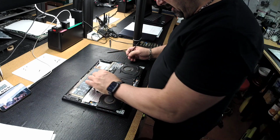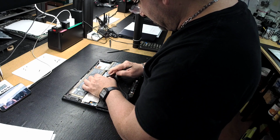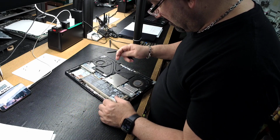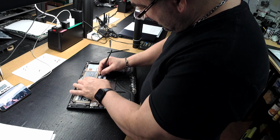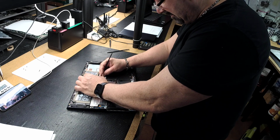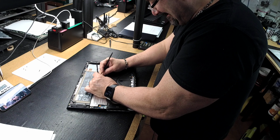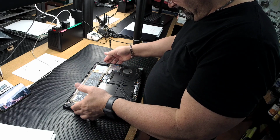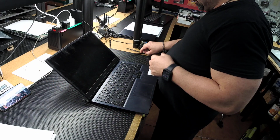We'll also clean it up back here. So the battery, just a little push back. Don't pull it by the cables. You should almost always have like a little, usually like a little tab there on the side, almost always. Should be able to get it. And side to side, if you can grab them both and push them both at the same time, even better. Remember there you got those little pins. You don't want to bend them. So that disconnects that.